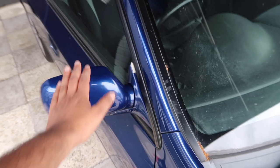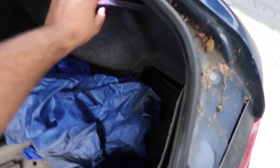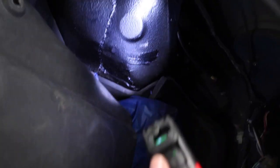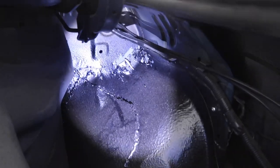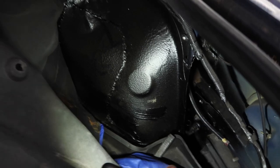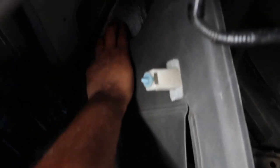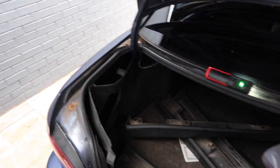One of the most important checks when buying an old classic Subaru — pull these arch liners down. So here we go: some of you were worried about rust going all the way through, but this is the repair that's been done on the car, all properly welded up. Quite a good job. Same on this side — pretty much the same thing, all good. You can kind of see now why I wanted to go for this particular one, even though it has weird wheels and an unpainted rear quarter panel. Some of the others I went to see were rusting all the way through. This one is solid, welded — the previous owner spent nearly £1,000 on that repair about three or four months ago.